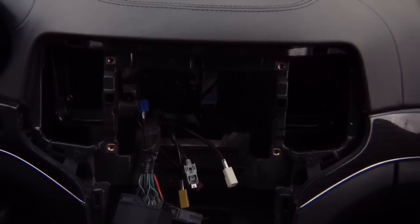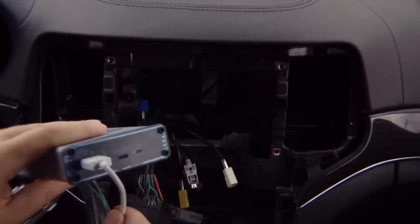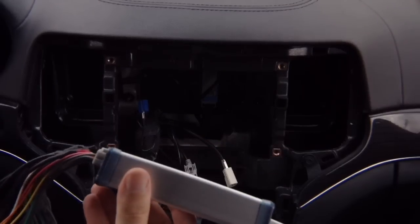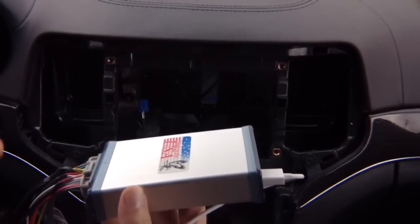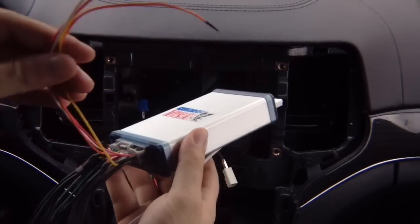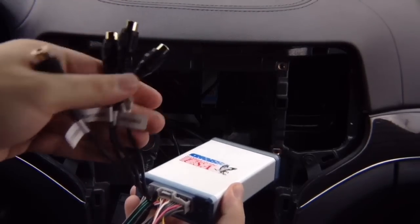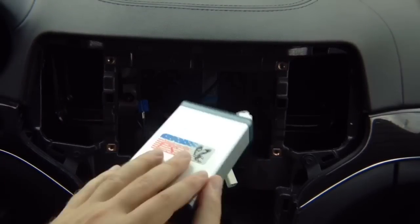This is where you plug in your iPhone cable, Android cable, or just USB. This is the programming port for the previous step. We're also adding cameras. If you're not adding any camera and you have a rear factory camera, you're done. But we're also adding cameras — before you close everything, you want to test everything to make sure it works. Connect the cameras to this box — we've got four RCA inputs, all labeled. We only need front, left, and right cameras. Let's connect the cameras and start testing.